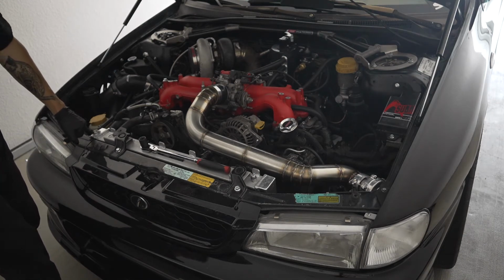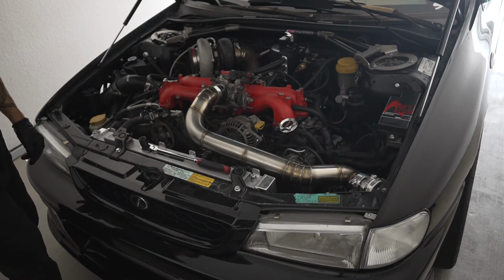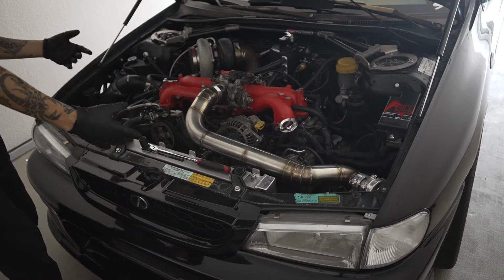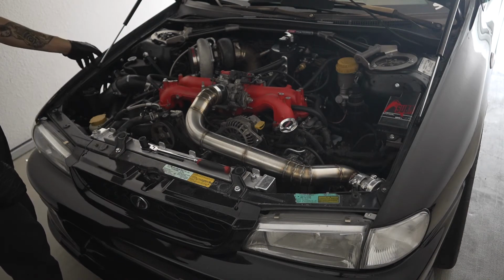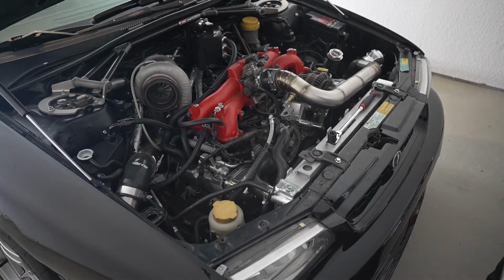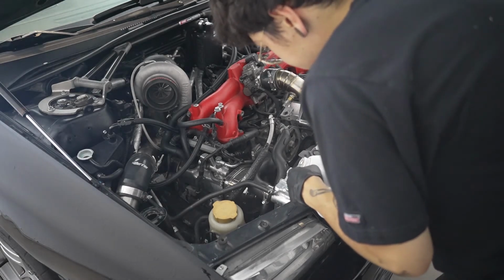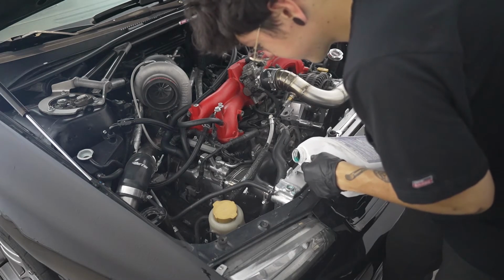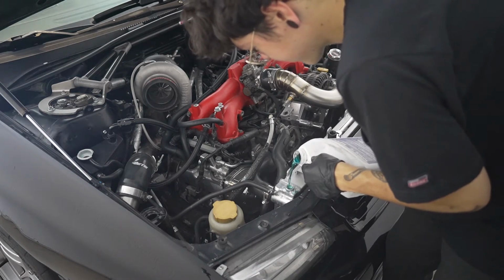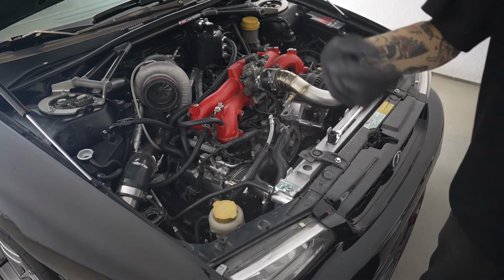I'm going to fill this one up first with the coolant I have in my bottle right now, and then fill up the radiator, massage all the bubbles or air pockets out that I can, and then move on to the expansion tank. All right, so I got my coolant all filtered out here. It might be useful for you to put a napkin or something right where this hole is, so you don't get coolant anywhere, like how I just did.